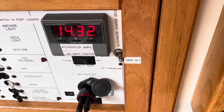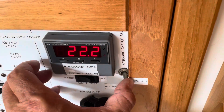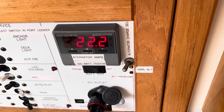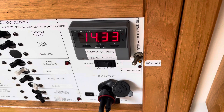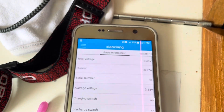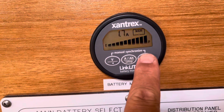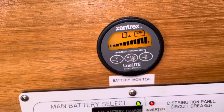Here's an example where I'm restricting my alternator, and now I'm going to take the restriction off. You can see I'm up to 22 amps right now. Now I'm going to put the restriction back on to 50%, and I'm still at 22. What I'm being limited by now is the algorithm in the voltage regulator, where it's not going to burn itself up. I'm charging at a very reasonably low rate of 18 amps. Looking at the lead acid battery state in this parallel mode, we're charging at a very, very low rate to lead acid — it's at 100% state of charge.